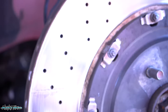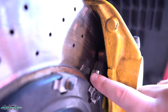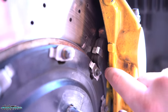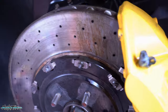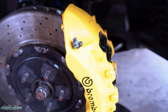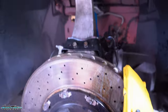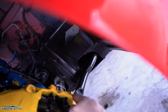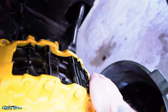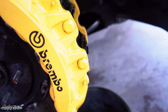These are probably the same rotors from when this car came out of Japan, so they're definitely well overdue for a replacement. You can also see the wear mark on the pad here — these front pads definitely need changing as well. Good thing we're doing it. I'm just giving the calipers a bit of a clean, nice and bright and shiny now. I'm going to have to remove these two bolts here — they're going to come off just to move this frame over because of the brake line. There's a bolt here, bolt there, and one underneath. So there's just three bolts. The top one's longer, so you have to make sure the top one goes in the right spot and the shorter one goes back where it needs to be.